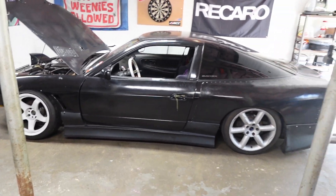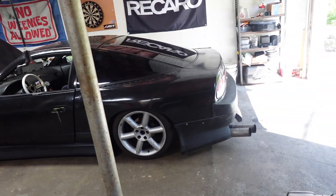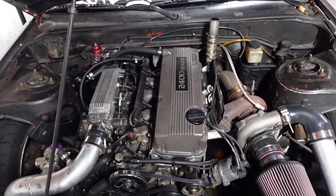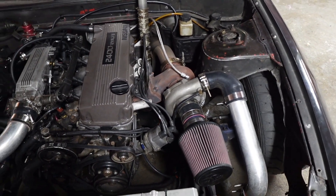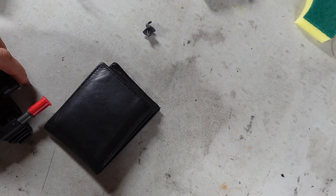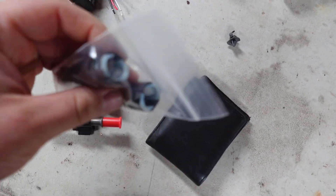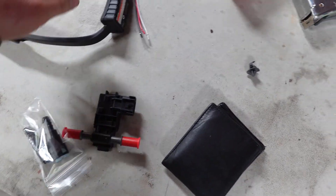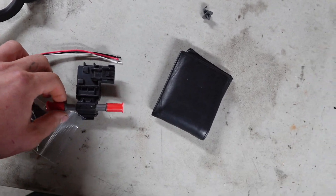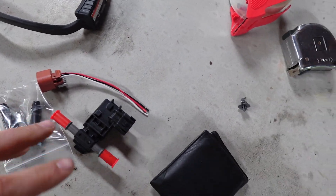Here is the '89 S13 hatch. This is the main drift car. Got a single cam turbo setup running on a MegaSquirt ECU. Pretty basic, running 16 pounds of boost right now on pump gas — it's kind of scary. So I do have this flex fuel sensor for it, GM style Continental brand, with fittings that go on each side. You run it to the return line, it's got the pigtail here, run it to the MegaSquirt and then it can pick up the ethanol content through that. I'll probably do that in a later video — installing that, getting that set up, testing it out.